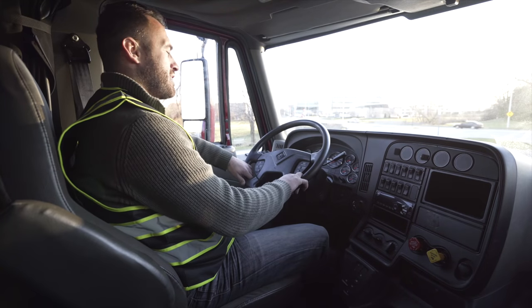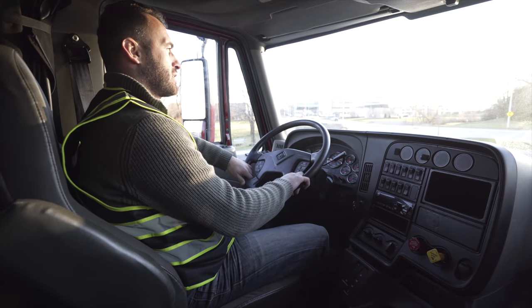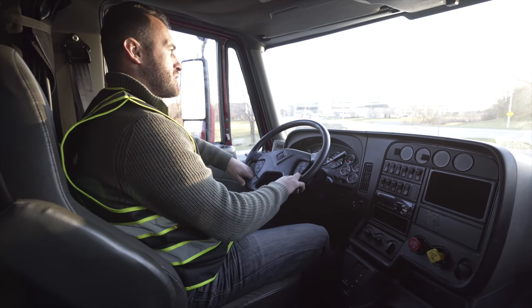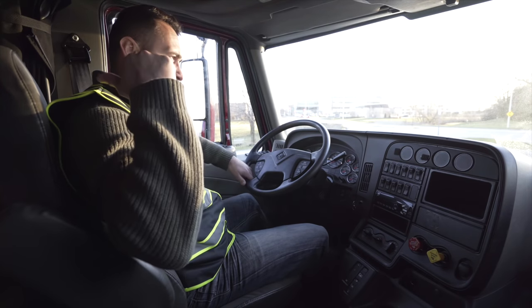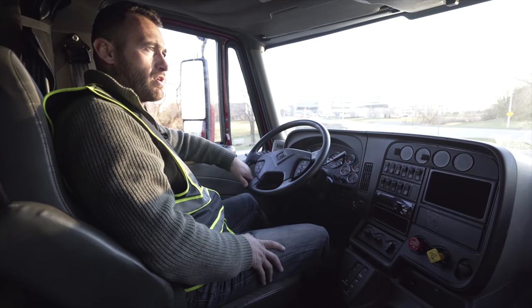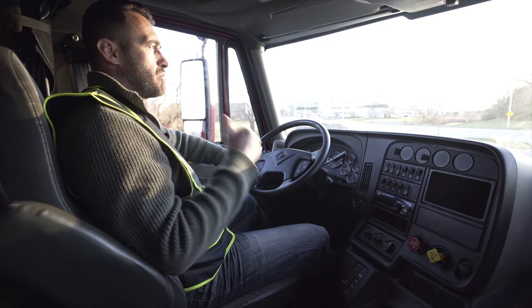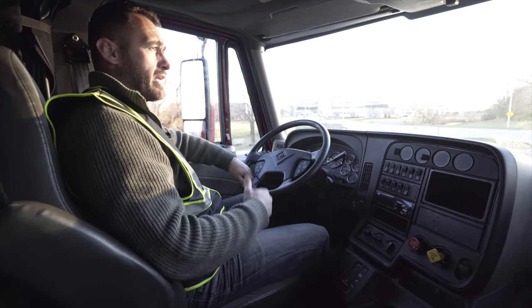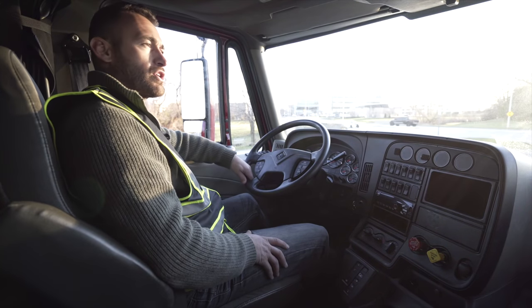Now I will be conducting the in-vehicle inspection plus engine start portion of the vehicle, which includes my brake test. Once I come in my vehicle, I will be starting with my three safety equipments. Fire extinguisher, fuses, triangle. Fire extinguisher is down in the cabinet back there, not broken, not cracked, secure, fully charged, and in the green. I got three safety reflective triangles, which are not broken, not cracked, and secure to the truck. And I should have some spare electrical fuses, which are not broken, not cracked, secure.